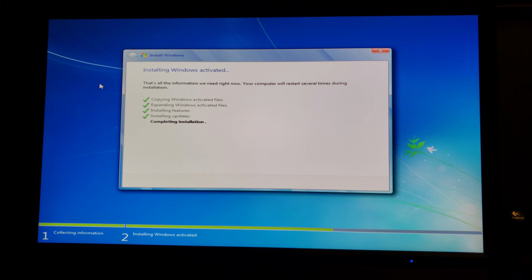But pretty interesting that Windows 7 is installing off a CD that's not even SP1, nor does it have any extra drivers on there. This is just basically an old Windows 7 CD and DVD installation I just had, which is literally tossed aside. So definitely keep that in mind. It's always still an option, and it does actually recognize the hard drives. I know some modern day computers using Intel chipsets and CPUs, Skylake for example, did give me that issue where it would not pick up the hard drive at all, and I did have to use some drivers, but the USB ports weren't working because there was no USB 2 port. So obviously I had to borrow another computer to piggyback the hard drive on and install it.